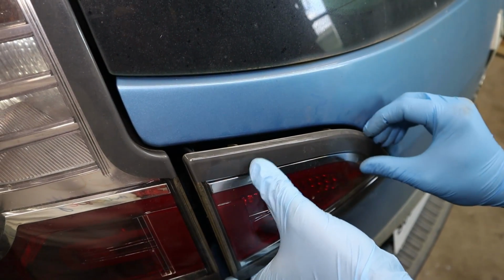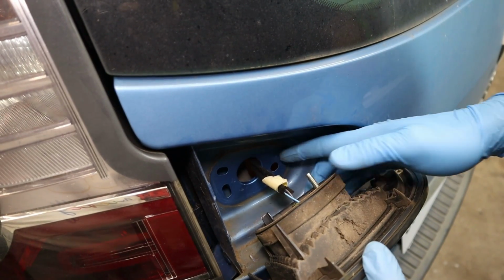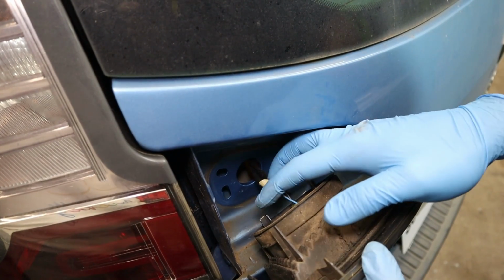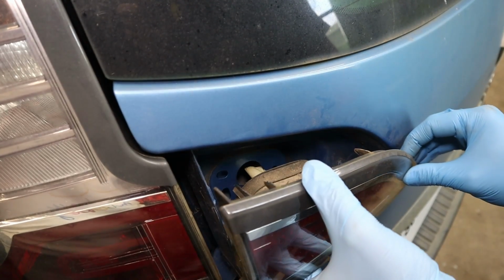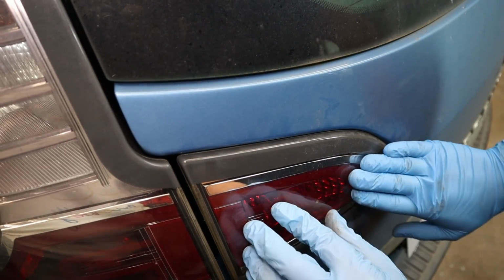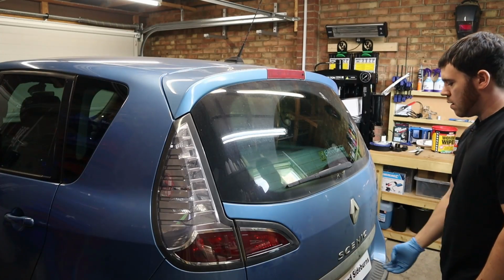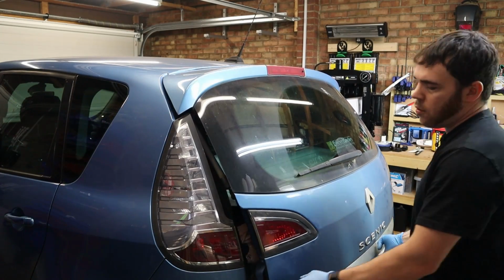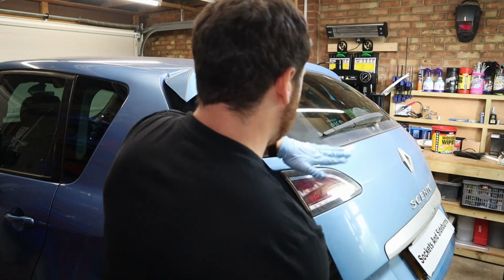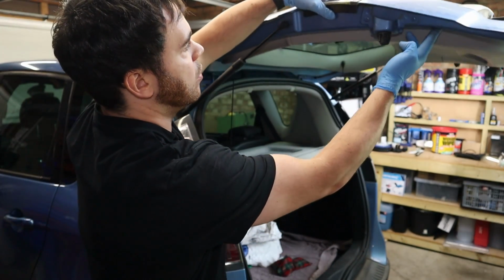Line up. You see the stud that we're going to be winding our plastic nut back onto, and a little peg there. Feed the wire in, line those up, and it should press nicely into the boot like that. We'll let the boot back up now. Just go slowly. Maybe hold on to that lens as you let it up, because that's still not secured, of course.